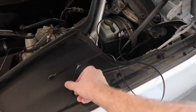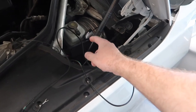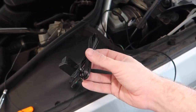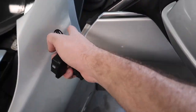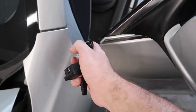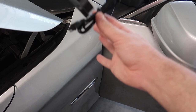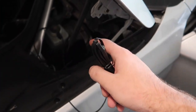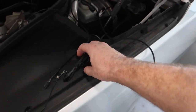Now that we're done with the engine bay, we have this ground wire — we'll deal with that shortly. What connects to this side is the OBD cable. There are two ways to do it: you can just connect it and tuck it underneath the fender, route it straight through, connect to your OBD, and since it's a thin wire you can close your door — no water will get inside. That's the easy way. If you want to do it the clean way, we're going through the firewall, which is what I'm doing so it looks super clean and OEM.